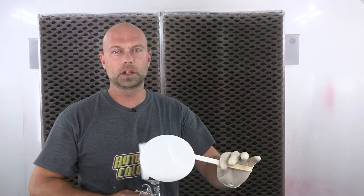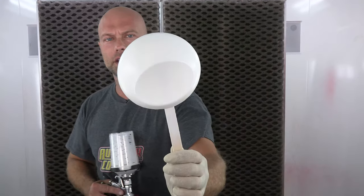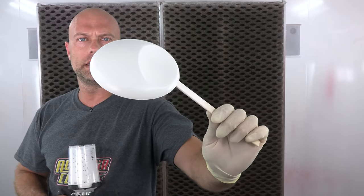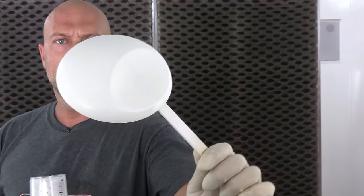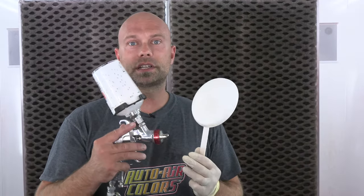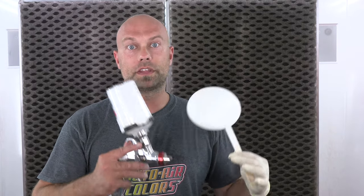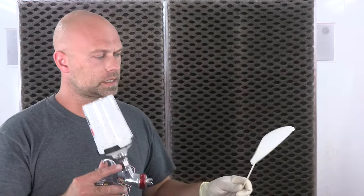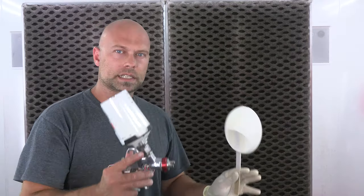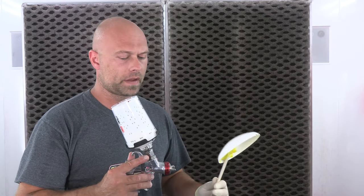Welcome back — our sealer white is totally dry. You can see how nice and even and smooth and flat that is, and that is key. You want it nice and even, because any texture you're going to see in your next step, and that next step is the application of our Wicked 361 coarse white metallic, which is going to be the perfect ground coat for the candy that goes on next. We're going to spray about three to four coats — quite a bit of this to get a real nice glitter effect, that real metallic effect.